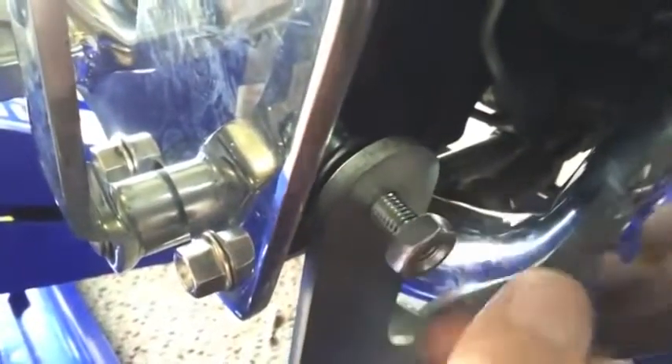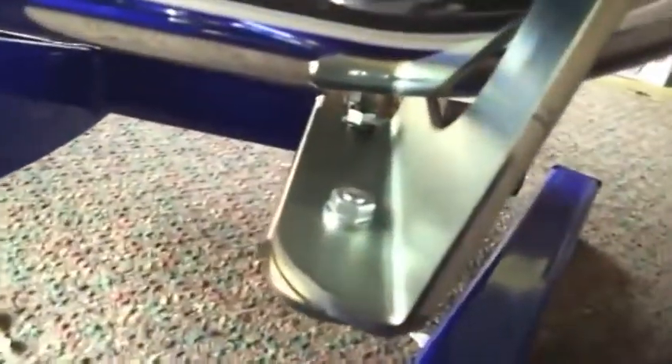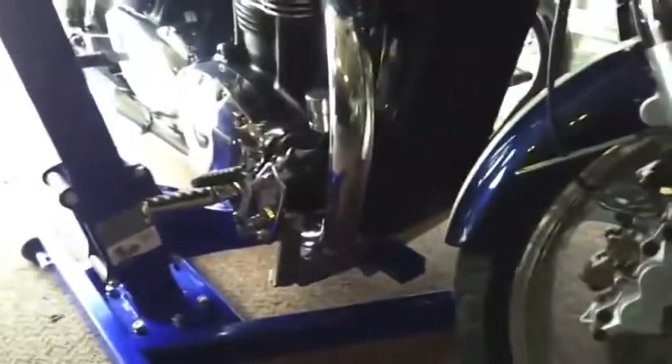Once you've done that, get the nut on and this time you need to start tightening it up good and tight. You'll find this is the difficult side because you can't get a spanner in the back. Remember to tighten this one on the other side too. I think 20 foot pounds is probably adequate for all of these. Don't forget to tighten these two underneath here as well. Now if you're happy that everything's tight, do one last look around for safety, check everything's right and the bike's ready for lifting.